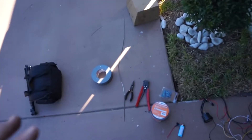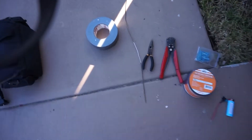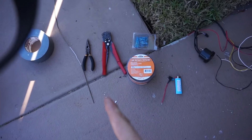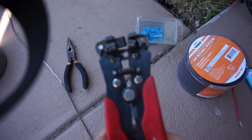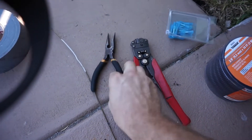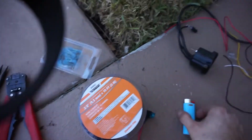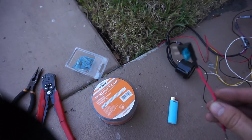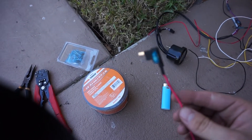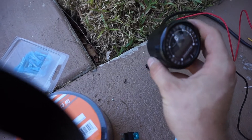Let's go over the tools you need — you may need more, you may need less, you may be able to do it with just your hands caveman style. But you'll want some duct tape, coat hanger, normal wiring stuff, some wire loom plastic, connectors, a wire splicer, a lighter — I like to always use the heat-shrink connectors. I did have a butane torch but my brother probably stole it. And a fuse tap — this is how we're going to easily connect to an accessory power source. The ethanol gauge itself is an Innovate ethanol gauge, I got it on eBay.